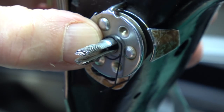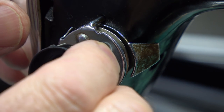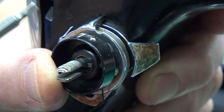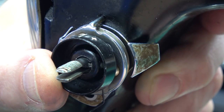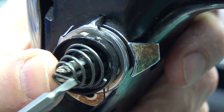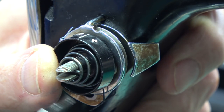Then put the rest of that spring arm on. The spring is still at six o'clock at the moment, you've got the two tension washers and the cover done, and reassembly continues in the same order of components. So your plus and minus: the little adjustment sitting line in the middle, plus on this side, minus on this side — as I'm looking at it, plus is on the right, minus is on the left. Then your beehive spring: make it so that the lower bit of the spring that sticks out most is in the lower position, so it's more recessed on the top. The spring sticks out underneath.